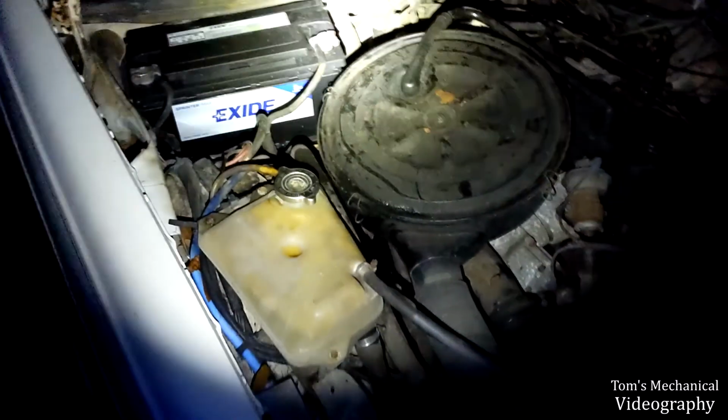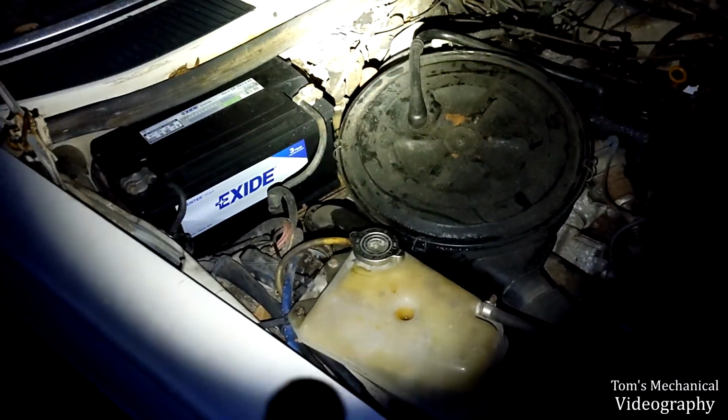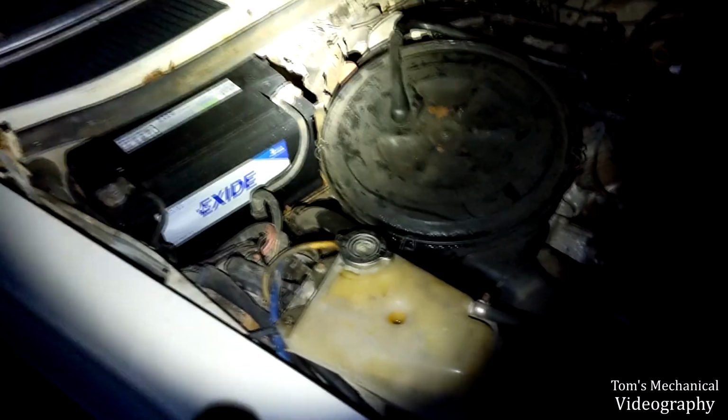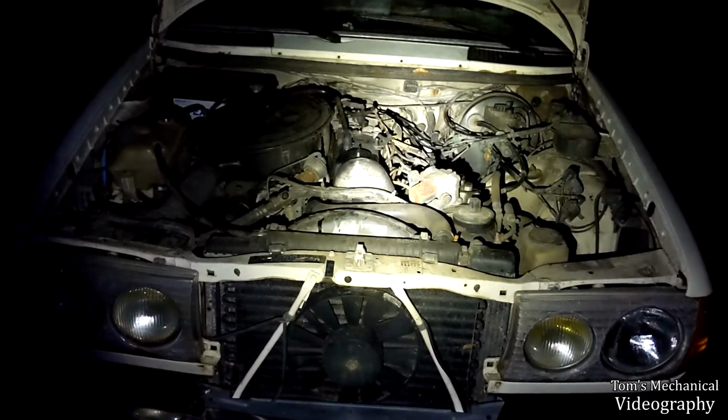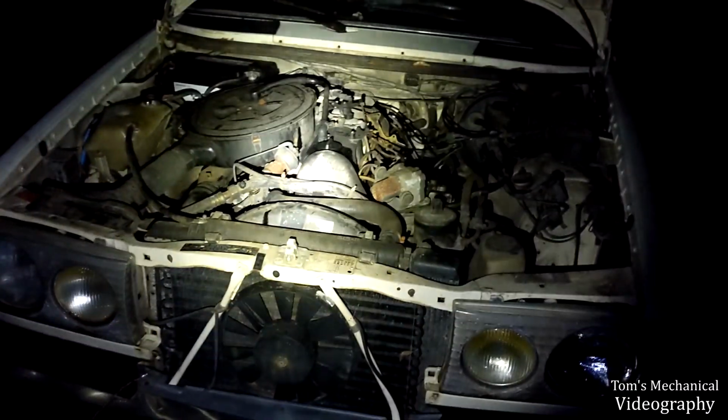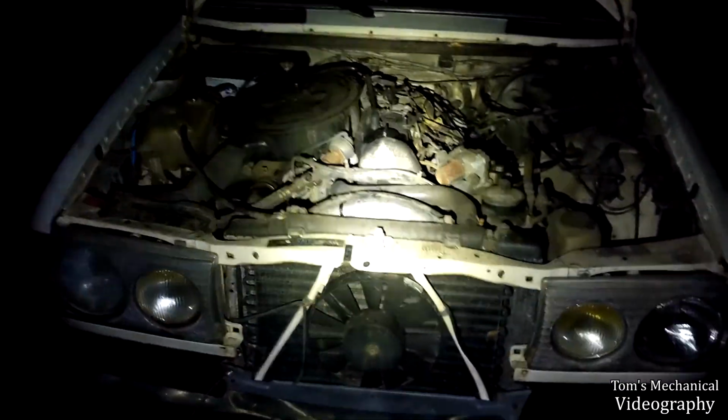It's probably with the thing running and warmed up with the thing in neutral like it is with every car, and I don't know where the mark is on there. It's got a lower squiggly on there, and it's halfway below the lower squiggly in park with everything warmed up, so she could just be low on transmission fluid. I'll look into that.